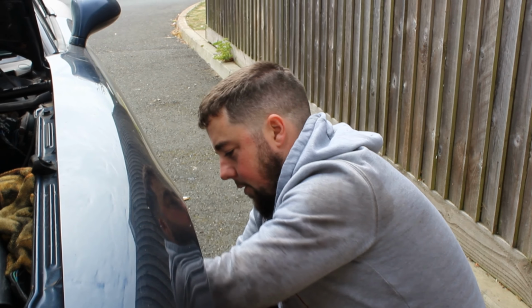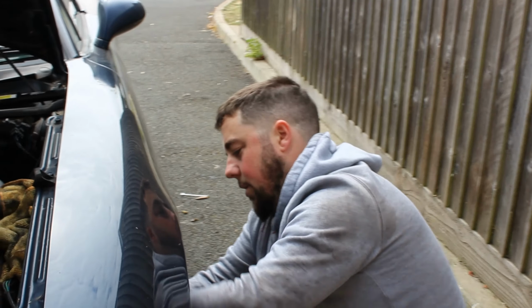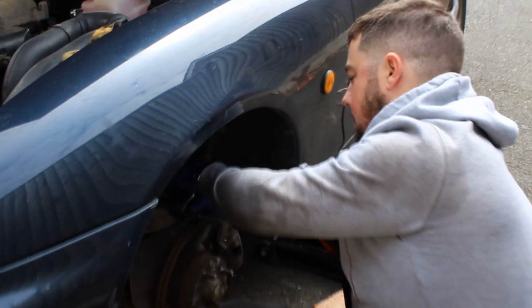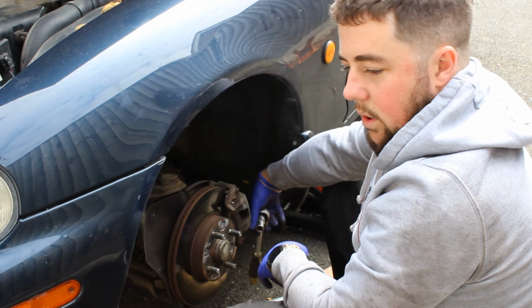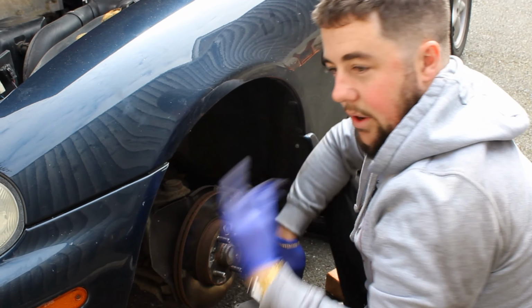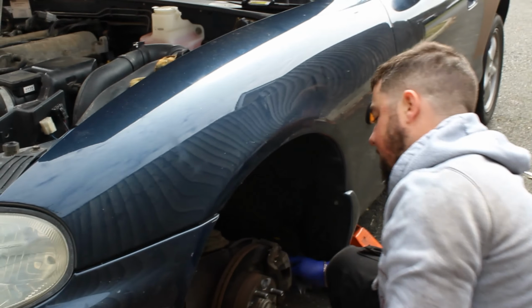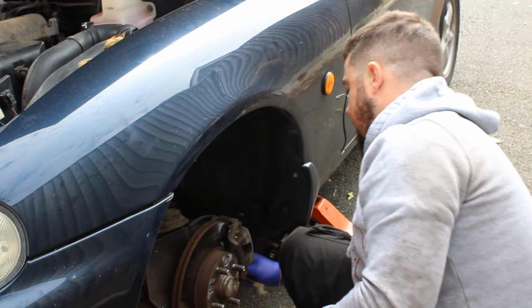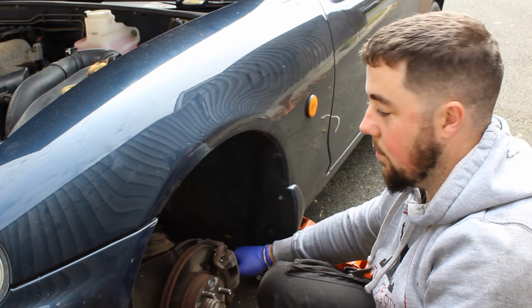Right, so what we'll do then is I'll put these back in and then try it, because I want to know if that fluid has actually made any difference at all. Because if I change the pads, then they're more likely to be better, and then I won't notice the brake fluid change. So, I'm going to change them after I've driven it around for a bit, because they're not that bad. Because I want to notice the difference. Basically, I want to know if the fluid actually made any difference to the feel of the pedal that I had. A couple of days.